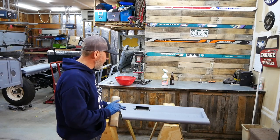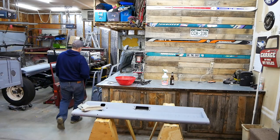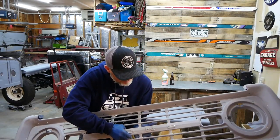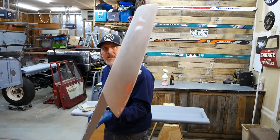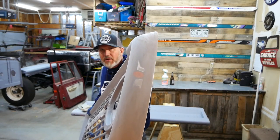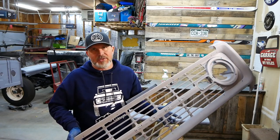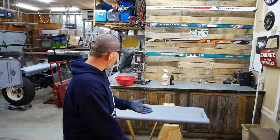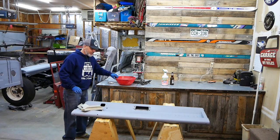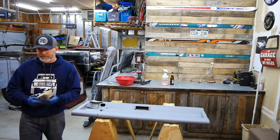I'll do it all wet so I can keep from burning through. On the grill — I already did the grill and it burned through in several spots, not very big, just a little bit in the lettering. I had some spot putty repair done on one side and you can see where it burned through to the metal. This one will have to be sprayed with a light epoxy and then another primer and sanding. I'm going to try not to do that to any other panels. I've got my water, sanding sponges for the curves, and my straight sander — we're going to go to work.